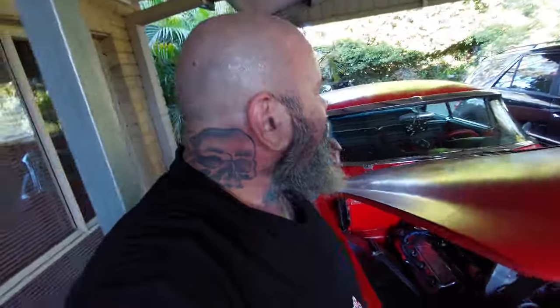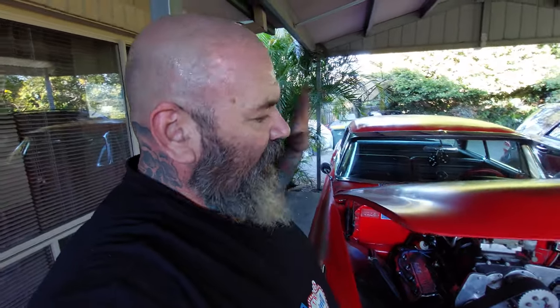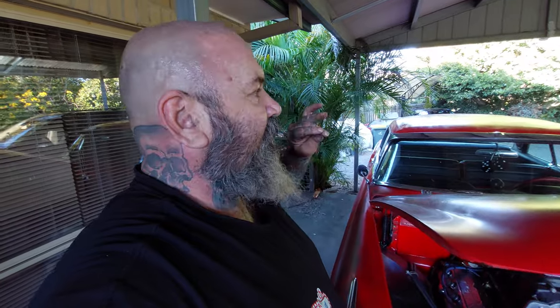We just had it running. So now we will close the bonnet and we'll come in from the top and we'll check that rear float again, see if we can set that float. If we can get that rear one nice, we'll probably look at the others. And if we can get them nice, it should run properly, shouldn't it? Unless we've got some issues with the needle and seat, could be leaking, or the power valve as well could be having issues. So we may have to pull that down later, but let's try the next step.